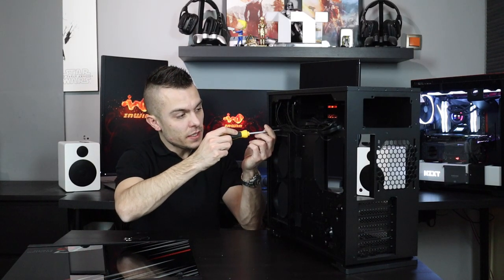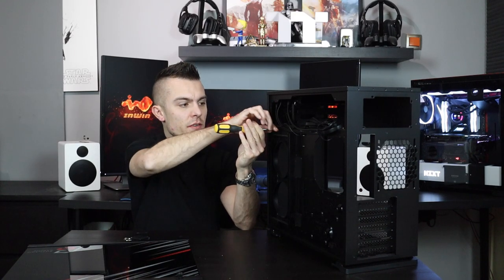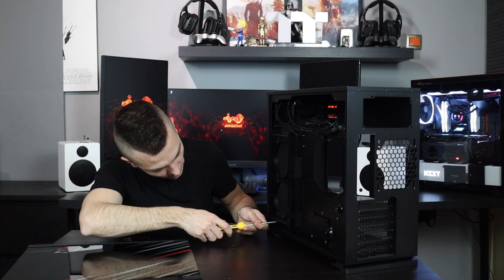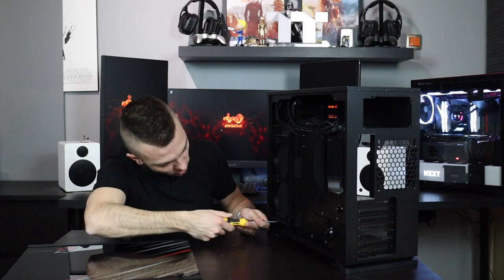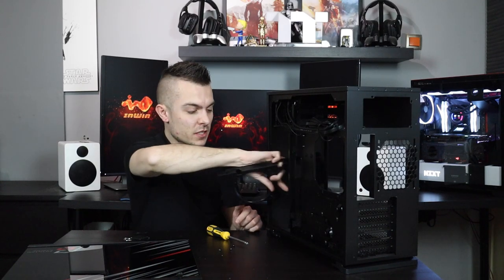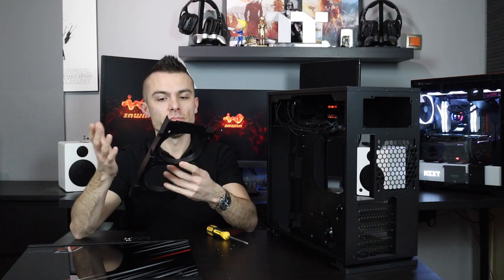This right here is the mounting for your fans or radiator and fans. The interesting part is you can easily remove it — just remove two screws at the top which release the top side, then one more at the bottom, and you slide it up. This releases the whole panel so you can practically manage everything right here.